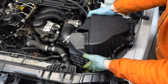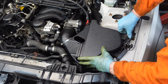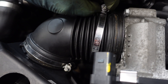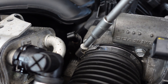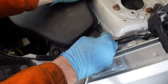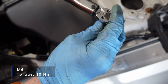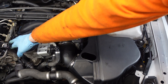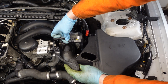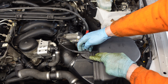I have to make sure that the airbox sits on the rubber bushing. Then I can reattach the rubber bushing to the throttle housing and put back the clamp and make it tight. Then I can also reinstall the two 10 mm bolts and torque them to 10 Nm. Next I can reattach the wire harness and connect the throttle body and the mass air flow sensor, and put back the grommet.